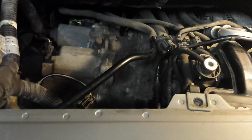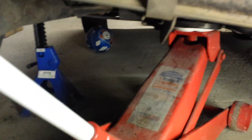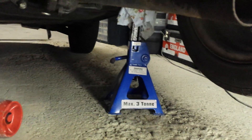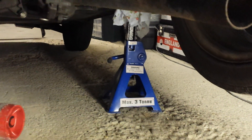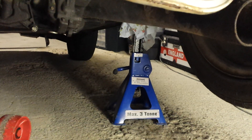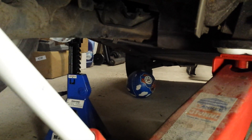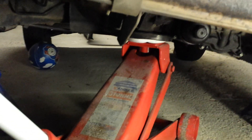Lowering just one side is sufficient to get access to a lot of the components. The point I want to cover now is how I've actually jacked the car. I have two axle stands for the vehicle — the blue one at the back on the left-hand side and another on the right-hand side. I've put rags on top of the axle stands to make sure they don't scratch any of the plastic parts, keeping all vehicle components safe.